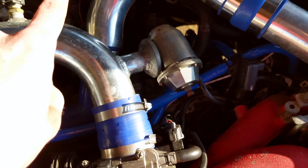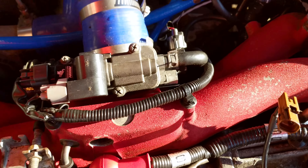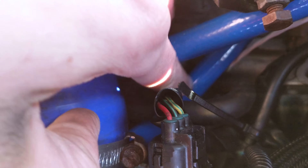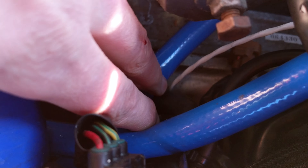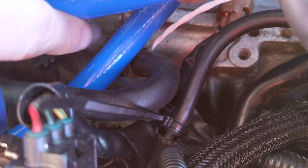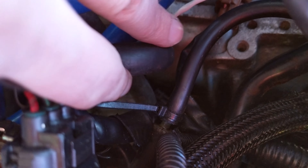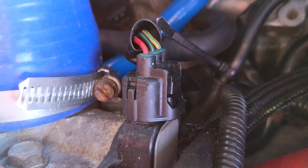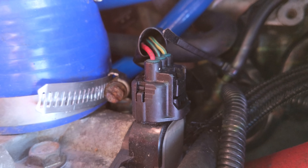If you have a top-mounted cooler, you will have to take it off to get at it, because it's down in here. See this white wire? That white wire is my new shielded knock sensor cable that goes away to the ECU. And down deep in here, behind all these pipes — if you follow the white wire down — there's the knock sensor. You can't even see it. If you push those pipes out of the way, you can get it with a long ratchet extension. I'm sure it's a 10mm, and it just has one bolt through the middle of it, unbolts, and out it comes.